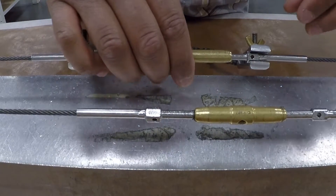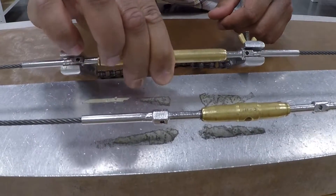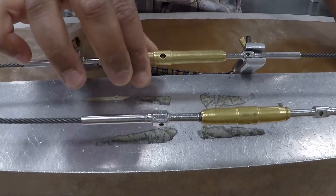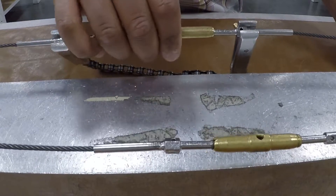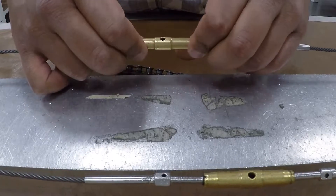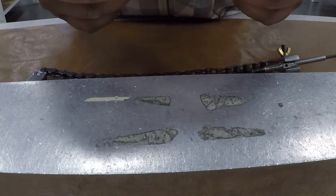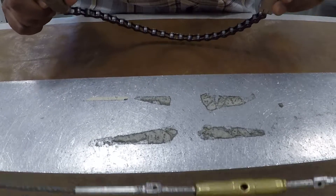Now when I go to loosen the turnbuckle — loosening direction — you'll notice that the cables are in the same position as they were before. They're no longer twisting. So that is why we need to use a turnbuckle cable clamp for removing turnbuckles. Let me take that off for you. Each of you will have a chance to remove this from an actual aircraft as well. We're not going to be removing it from these modules — I just used it to show you how to use these cable clamps.